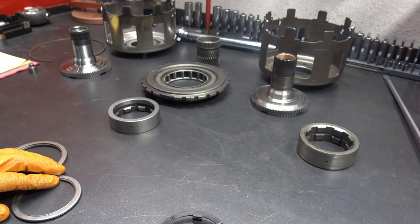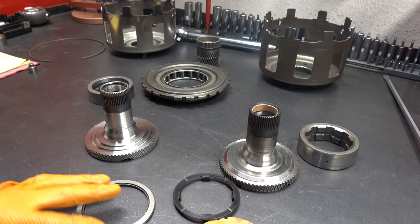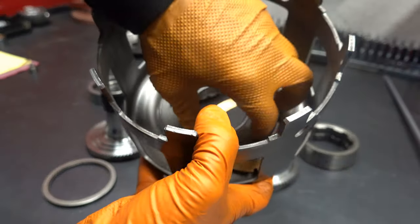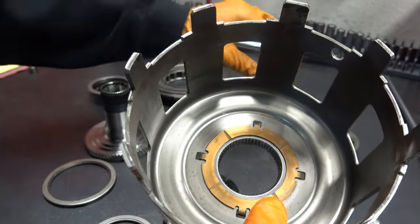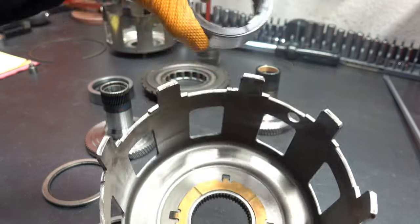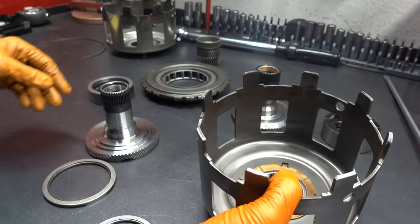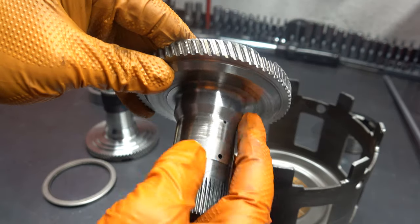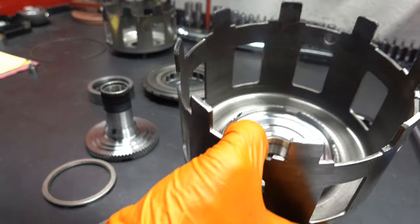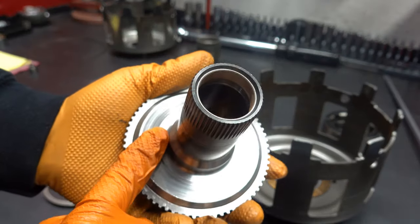The third pieces are the bearings themselves along with the reaction shaft. The reaction shaft splines onto the forward ring gear and then inserts into the transmission right in front of the sun shell. In a factory application, you'd have your thrust washer on the front side and then a black thrust washer on the center support side. Then this would spline in, and there would be the rear sun gear that the shell splines onto. Up through 2003, all 700R4s and 4L60Es had this standard reaction shaft that is flat in the area where the thrust washer goes — it's just a static thrust surface, an area where heat can build up.